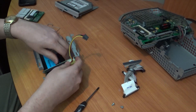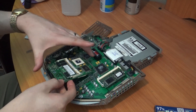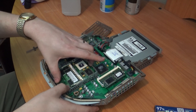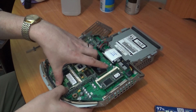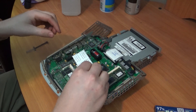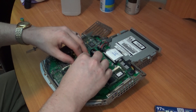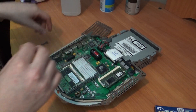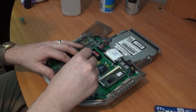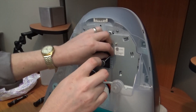Once the hard drive and CD-ROM are installed, it's time to reinstall the processor card. There are two connections the processor card has to make to the motherboard near the back — once those are secure you can put the heat sink onto the processor and attach the tension bar. That tension bar is the only thing that holds the heat sink onto the processor, so you want to make sure you get this right and it's sitting perfectly.